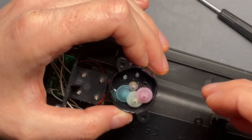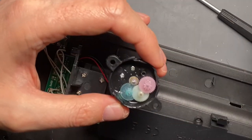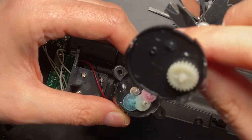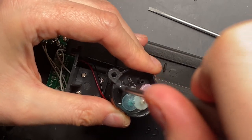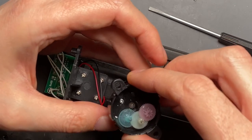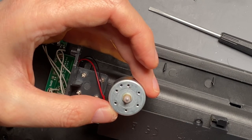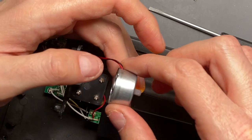It's getting quieter, but not great. I wonder, is it also the bearing in the motor itself? There are two screws here — I'm going to take the screws out. There's also one more drive gear on this side for the effect. It seems like it's well lubricated, but definitely on this side with these three gears in the gearbox and then the fourth that is the drive gear, it is not so well lubricated. Here's the motor by itself. Let's plug this in and see if we hear any sound. Yeah, it's coming from the motor itself. Relubricating these helped a little bit, but it's the motor.